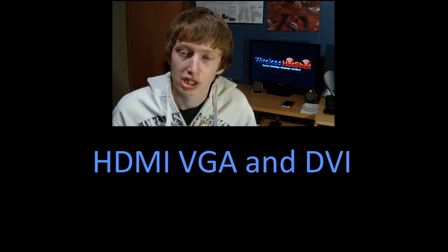The three ports it has for display are HDMI, VGA, and DVI. I use the HDMI all the time, though sometimes I don't now because audio through HDMI only goes to a TV — you can't have headphones plugged in. So I just use the DVI regularly now so I can use my speakers.